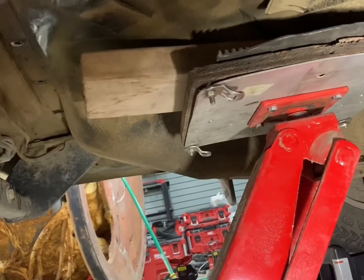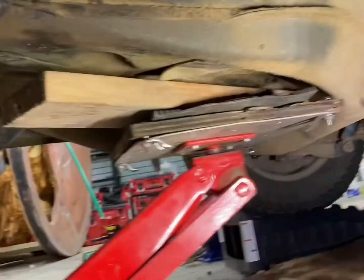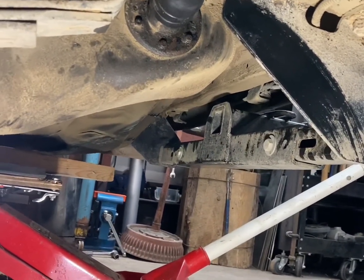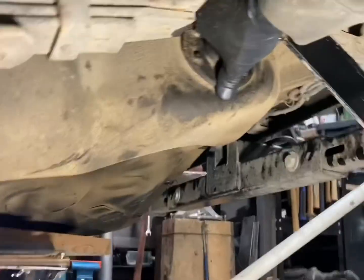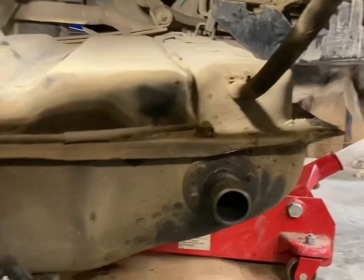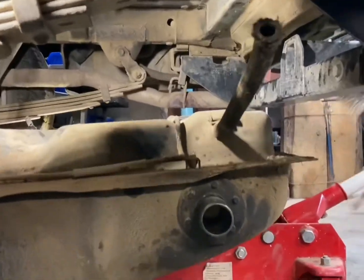Using the floor jack to support the tank, once the bolts were out I was able to let it down a little bit. I've got help tonight from my good friend Mark and Charlie in the shop — it's definitely a two-man job. He's running the jack while I'm under there kind of wiggling and pushing. I've got the filler hose there, and there's a little vent hose on top — about a 3/4 inch one — to contend with, as well as the wires for the sending unit up on the front. Working around all that, we were able to take it out.